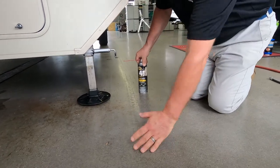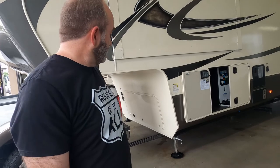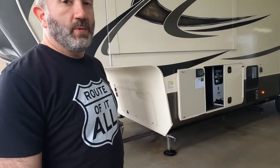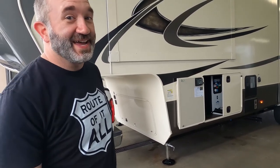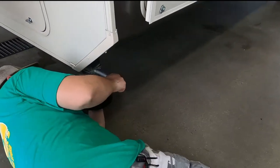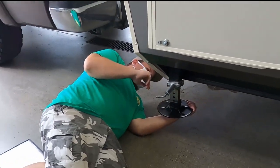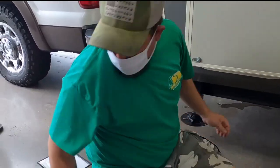All right, let me go talk to him about it, see what the landing gear pin looks like. It's bent or not quite aligned right. We won't be able to retract the jacks until that's fixed. We're kind of stuck right now. I see, you might fix. I don't know if it's... That bracket is out of alignment. This one, yeah, this just needs to be tilted up. Let me grab some wrenches real quick. Okay. Thanks, man.